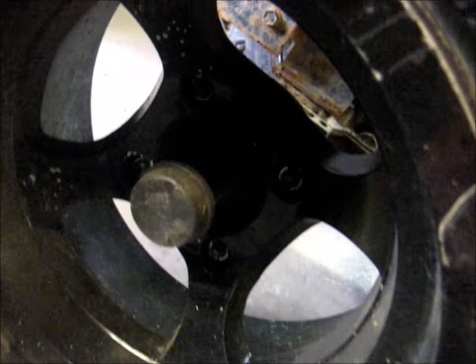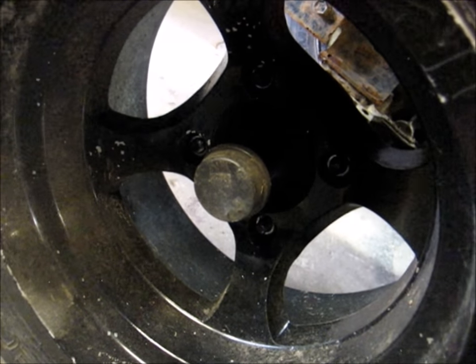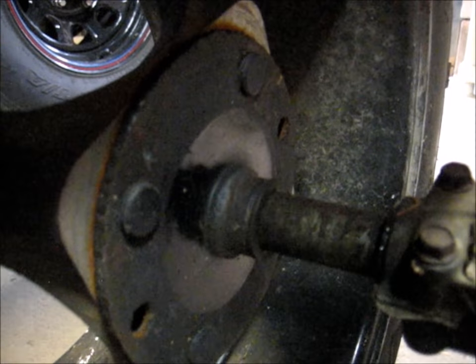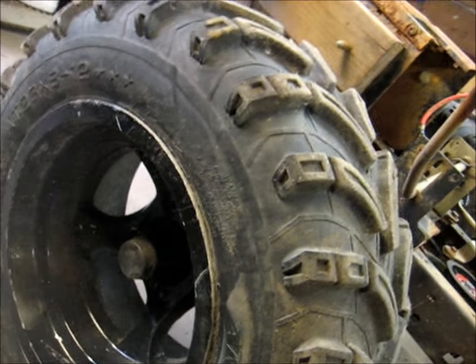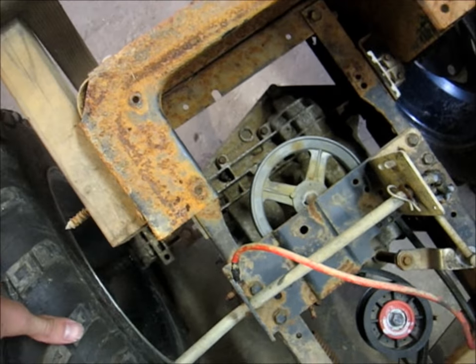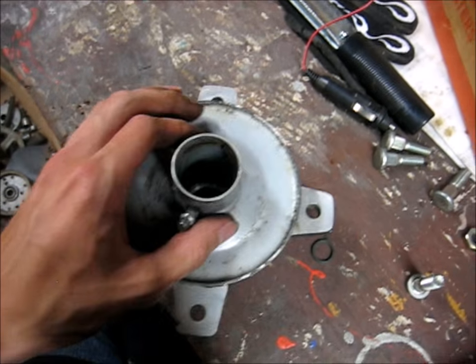This is actually exactly what I did to my back wheels — I took the factory rear wheels off, cut the actual rims off. Because the bolt pattern is smaller on these wheels, I was able to just drill the rear wheel and put some studs in there and use that as a hub to hold my 23s in the back. You can see it all goes on there real nice. These are a pretty tall tire for this transmission — it's actually got a solid axle all the way through, a one-piece axle, so it's a good bit stronger.